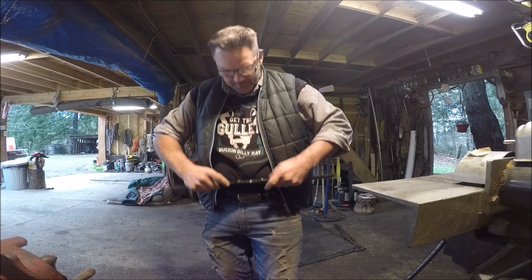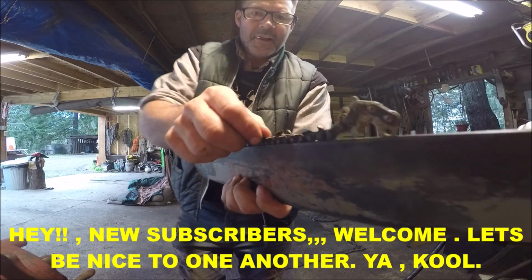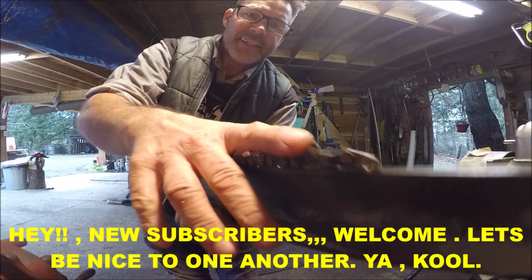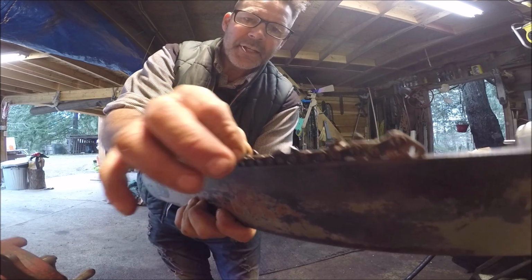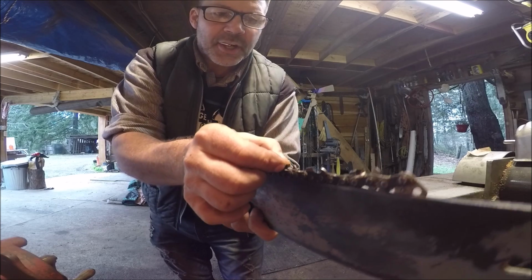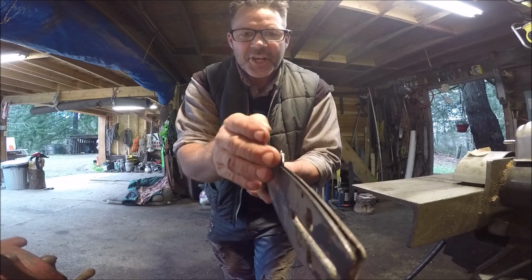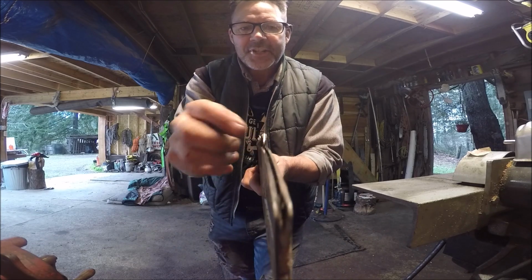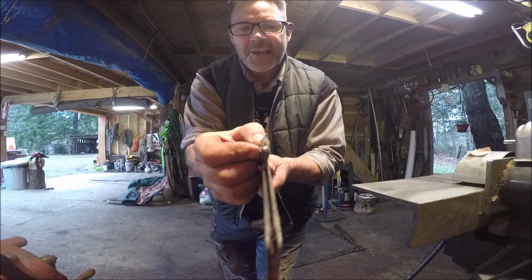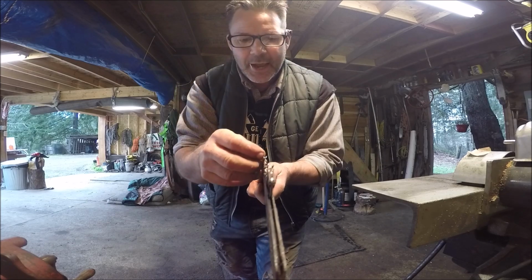You could probably almost see this laying down on the side. Look, these go through here like this, your bar rails, right? Okay. So it's going to lay over to one side more than the other. If you've got a groove that's been worn on this side more, then the chain is going to grab and lay over like that, and you're going to be cutting on an angle. Hands down, that's what's going to happen, friends.